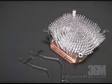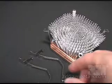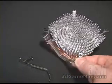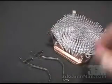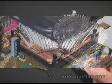Installation of this heatsink on the socket 478 is quick and easy. You do not need to remove your motherboard to install this heatsink, because it doesn't use the existing mounting holes that are on the socket 478. Rather, you use these spring clips — they go rested on either side of the heatsink and then just snap into the plastic retention bracket on the motherboard.